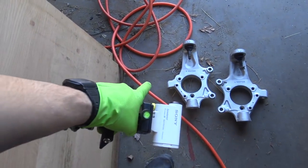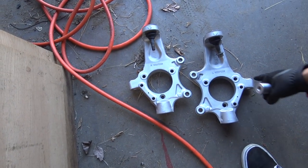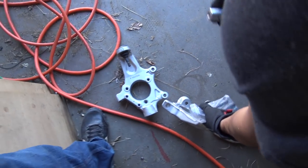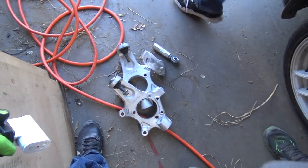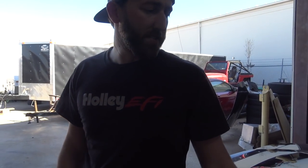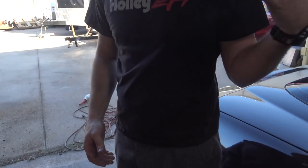And so basically, you guys just have a shortened tie rod pickup right there? Yeah, CNC shortened cut, and Nick can explain a little bit better. He's the one that designed all this stuff. We took a factory knuckle, and we're essentially modeling after the S chassis, because a lot of people don't know that the C5 platform and the C6 are all parts interchangeable. And actually all four knuckles at all four corners are the exact same.